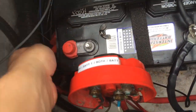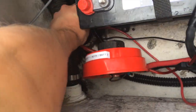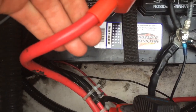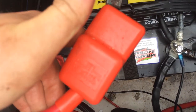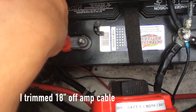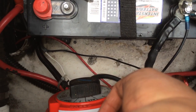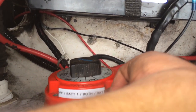It's still connected to the battery by this very large and short battery cable, so it's not like I increased the distance from the amplifier to the battery — because that's what you really don't want to do with these 12-volt amps. But this gives me a little more safety and flexibility, and it's really easy to do.